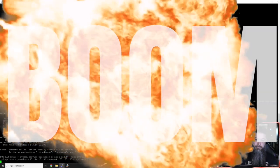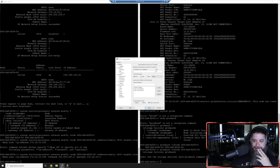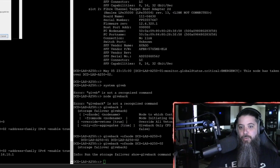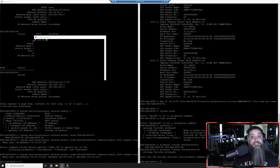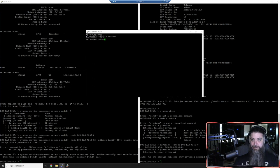Boom - update. And there she goes. Now that IP address - 172.16.10.236 - what could we do with that? Let's go over here and open an SSH session to 172.16.10.236. Same credentials as your cluster - admin credentials and your password. And look at that! This is where things get real fun. Now you've got 'system' and you've got 'BMC' in this SSH session.